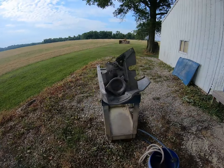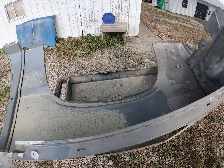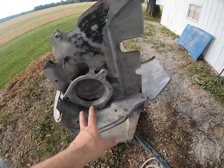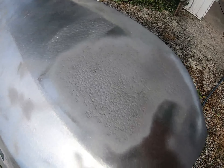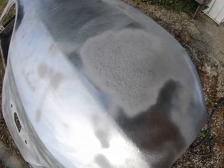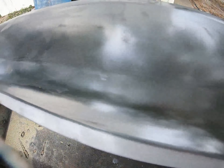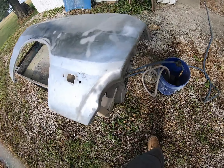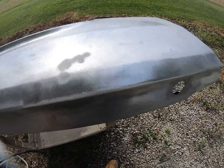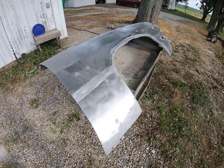This is our outdoor sandblast setup for when we can't fit things in our built-in cabinet. You are kind of limited in how far you can reach around the sides with the cabinet. After cleaning up all the extra stuff, let me show you the other side — that bed was all heavy surface rust and pitting. Now there are just some very minute traces of it here and there. Anywhere you see that kind of matte look, that's where we touched up — probably old scratches that got in below the paint and rusted. We're just going to go through each panel, clean them up, inspect them well, and find all the little issues.